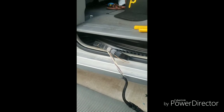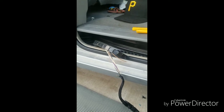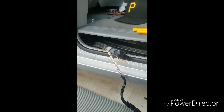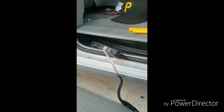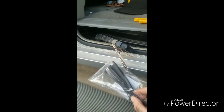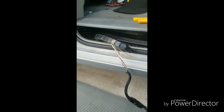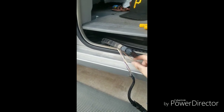I made this video because I had some trouble finding information. I have a 2009 Volkswagen and had some trouble with the sliding door on the passenger side — none of the buttons inside worked to close the door. It would work fine to open it but not to close it. I found that a black wire on that side was completely separated, so I soldered it and used some heat shrink, and it worked like a charm. We decided to check the driver's side door because it was having similar issues, and it was held on by just one strand.